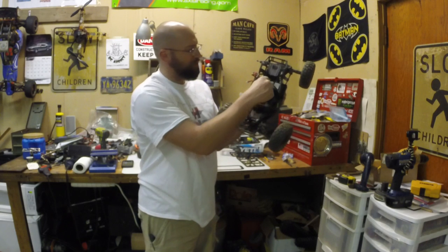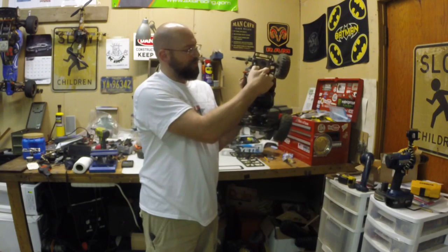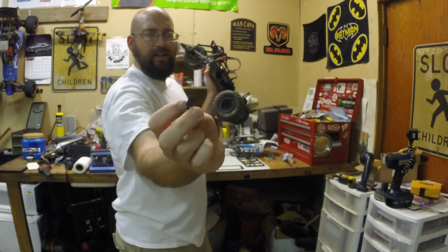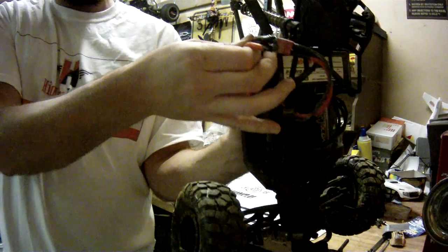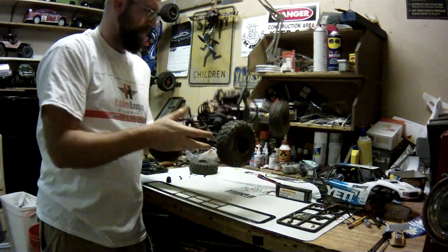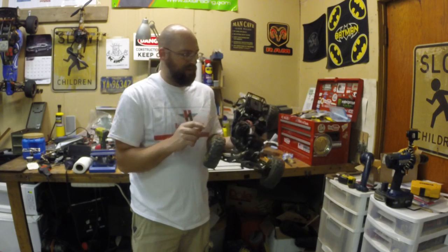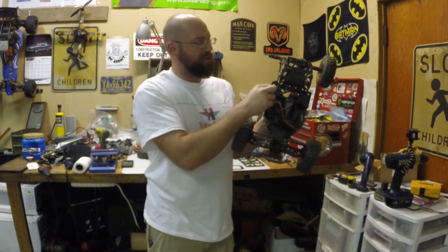Battery mount placement is actually really cool. Battery straps right behind the motor and it's got an adjustable battery mount depending on how big your batteries are. You move this strap — there's an X-strap here with four screws that moves up and down, and the screws have notches so it can't slide. There's a pin with a little gripper on it — I like the little grippers, that's a good idea. This little door opens up and the battery pack just slides out. That works really well. Puts the battery towards the back a little bit, which helps center it out. It rides a little bit higher but it's a better battery setup than say the Twin Hammers, where the battery was way back in the tail.